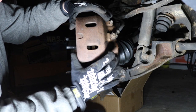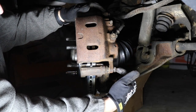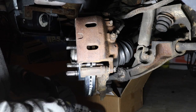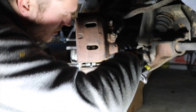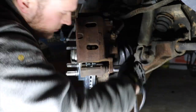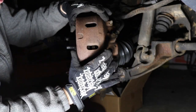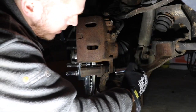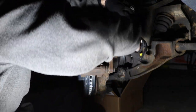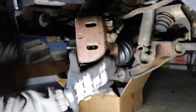We've put the caliper back over the new brake pads — same way you took it off, just slide it right back over top. Then you have your two bolts, one on the bottom and one on the top. We're actually going to tighten this with a hand tool because we don't want the possibility of breaking these bolts. Compressing the pistons in the calipers is really important because if you don't, it'll be almost impossible to slide the caliper over the new brake pads since they're thicker than your old worn brake pads. Now that everything is assembled, it should look like when we started — make sure everything is nice and snug.